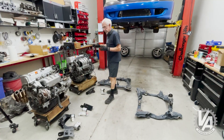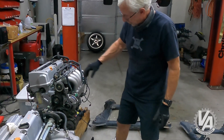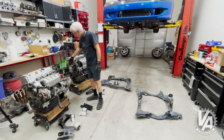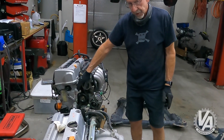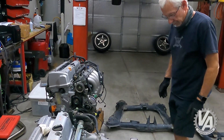Now, this is the motor we're actually putting in the car. This is a K24A2 — this is a TSX motor. This requires slightly different mounts. To start with, there's a block bracket on this side that is basically like the CR-V block bracket. It has the two holes on top for the mount to run. This particular version, which is the Haasport universal K-series block bracket, will actually fit a whole bunch of different K-series engines.